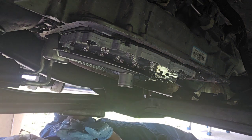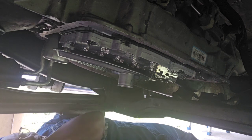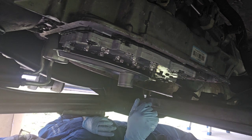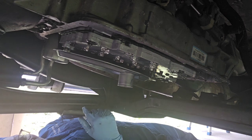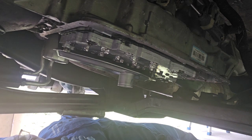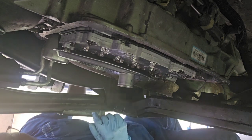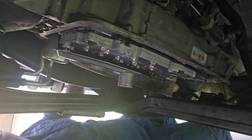And then once I torque the bolts and everything down, I'm still going to let it sit for a while again to kind of cure before I add fluid to it, right? So I'll let it sit for another just until I finish up the oil and stuff like that, and then we'll go from there. And then later we'll end up doing the transmission relearn. So let me go and get the oil pan and add the bead around it.